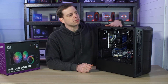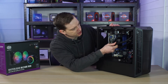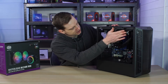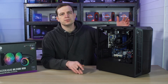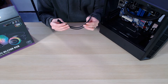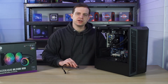Now that we've got the radiator installed at the top with all the screws in, we can put the anti-dust filter back on top and we can see that the pipes are actually pretty tight but they'll work. I don't want them to touch the graphics card when that's in there so I'll readjust them later. All we need to do now is a little bit more wiring — we have two fans at the top and only one front header, so we're going to use a four pin PWM splitter that goes from that header through the back of the system so we can plug all those fans in.